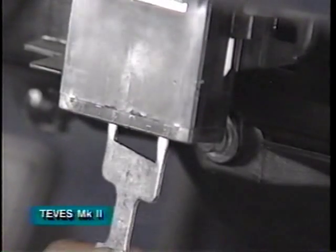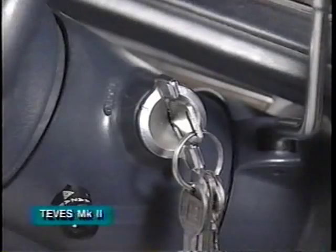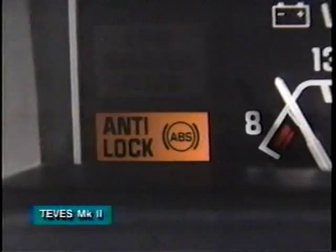Flash diagnostic codes are accessed only by connecting a jumper tool or wire between the appropriate terminals of the AL-DL connector. With the jumper connected, the ignition switch is turned to the run position. If the warning lamp illuminates, then turns off for approximately 3 seconds, and then begins flashing, a trouble code is being displayed. After flashing a code, the warning lamp remains lit steadily.